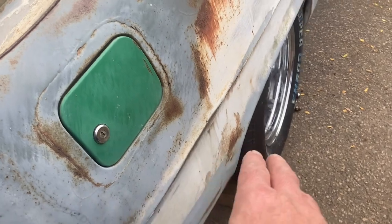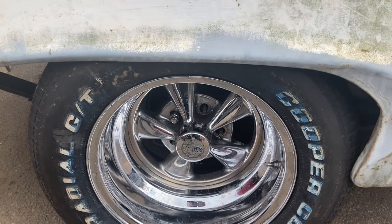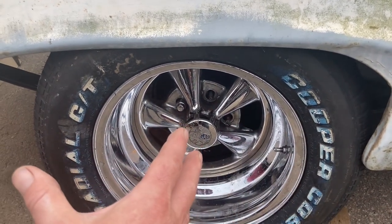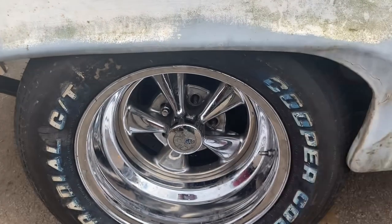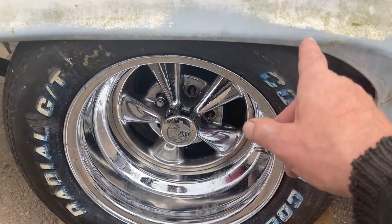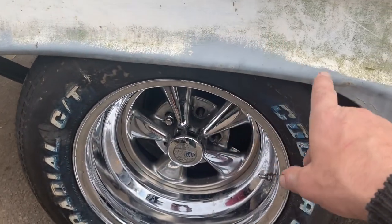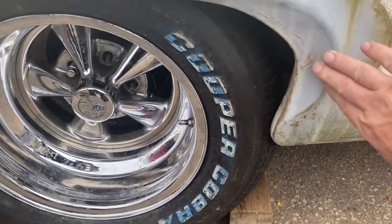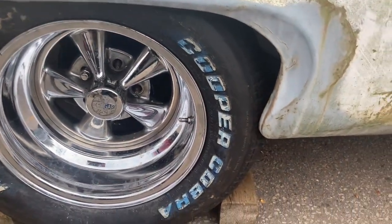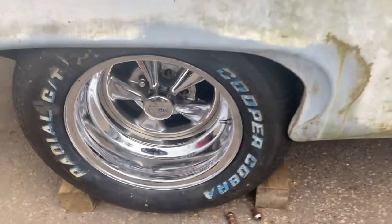That interference is spacing out the rear fender quite a bit because of that tire. We have several options: smaller tire, move the whole wheel back — in other words, move the body forward — or trim a little bit off here. I hate to cut too much because I like the style, but I understand I've got to cut a little bit. There are other options too.